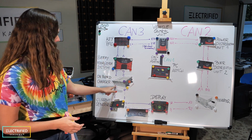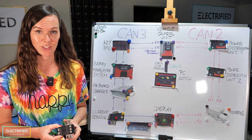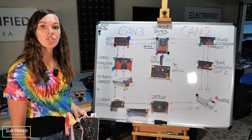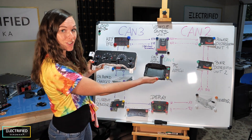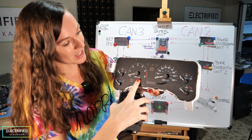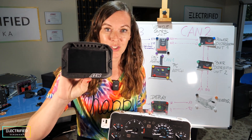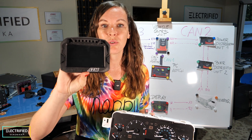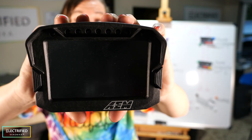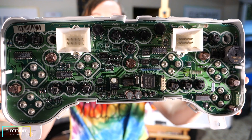The next component in CAN line 3 is the onboard charger — we talked about that already, we have it right here. Another very important part in CAN line 3 is a current sensor — in our case, Isabellenhütte — which is how we measure the battery pack current. CAN line 3 will probably also connect to the stock gauge cluster and finally to a customizable display. We are right now customizing all these signals to make more sense for an electric vehicle and playing around with different displays. For example, if you go rock crawling you can have a different display than when doing city or highway driving. Basically you'll have access to every signal transmitted throughout the entire CAN network.